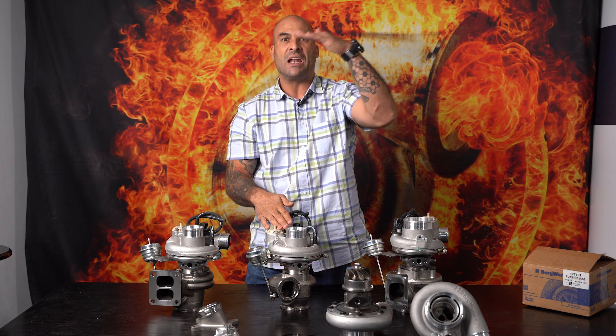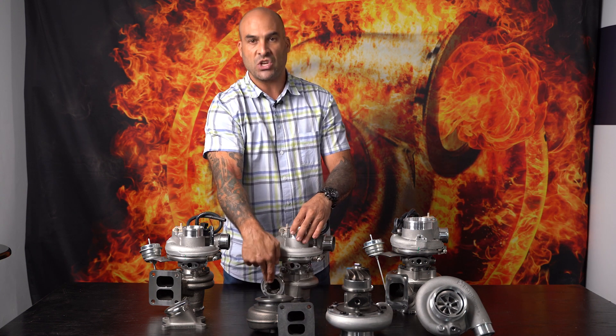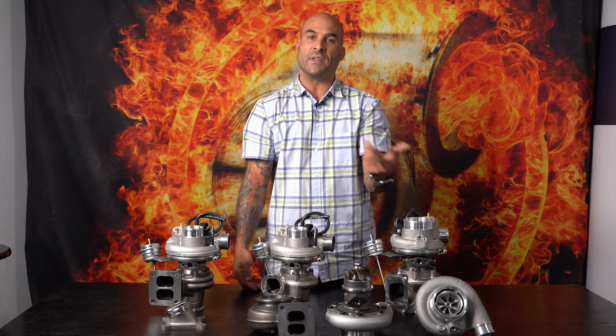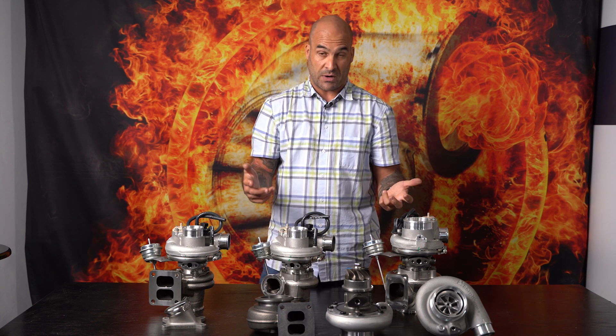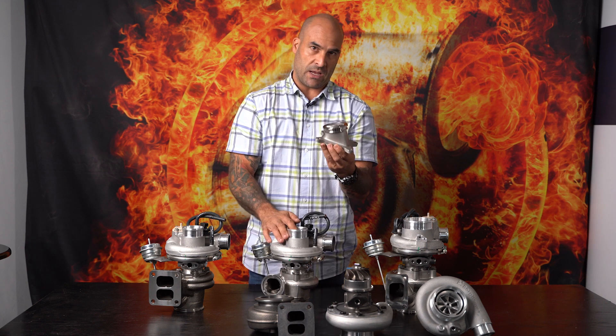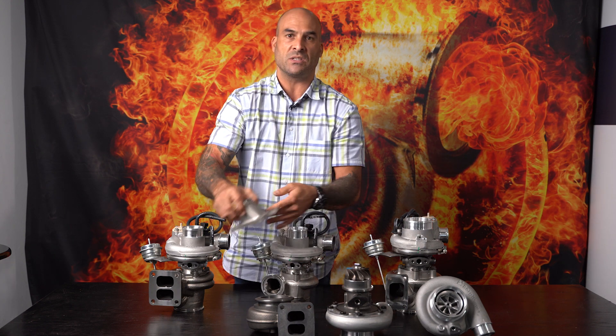Your torque curve lifts up and carries for longer in the engine RPM range. For guys that want a responsive low-down setup that carries power longer in the high RPM range and helps lift the torque curve without having to play with boost control, I would suggest the slightly larger AR turbine housing — the V-band in and V-band out, or the T25 in and V-band out, same AR85 turbine housing — together with the swirl adapter.